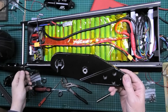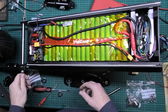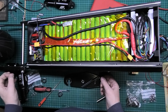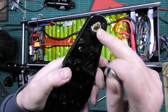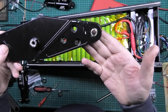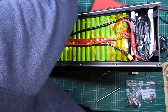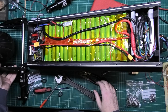Here's the swinging arm bolt. When I pull it up tight it didn't matter what I put in there — you can't move the arms, which isn't good because they've got to be free-swinging. So what I've done is fit a brass insert which is a press fit, and then there's a piece that goes in the middle of it. I add washers and a nyloc nut, and now these are free-swinging.